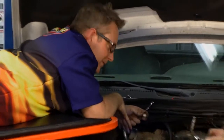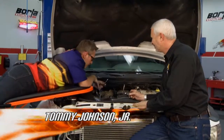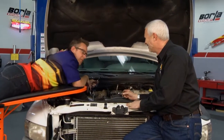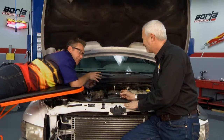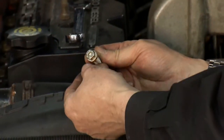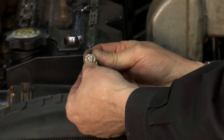Robert, I got the bolt out. It's kind of tough in here, and it was not tight — it was snug, but it wasn't tight, so they don't seem to be staying tight. Now I've got the Stage 8 Locking Fastener bolt. I'm just going to put it in, then we'll put the locking fastener on it and not have to worry about it coming out. You'll notice that just like our header bolts, there's a 3/16 Allen recess in here — what we call a double hex head.